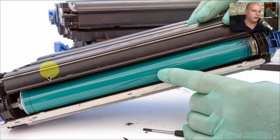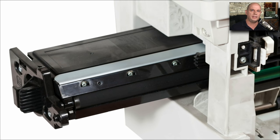Here's a good picture of the OPC drum. You can see this technician has moved the safety panel away from the OPC drum. Normally there's a spring-loaded cover on the front so that no light hits it. You can see it gets pretty messy, and this technician was smart enough to put gloves on, because there's quite a bit of toner still left on that OPC drum. The actual replacement is relatively simple — you simply slide out the existing toner cartridge and put the new one in its place. Some toner cartridges require that you remove a strip or piece of plastic to release the toner.